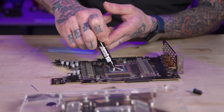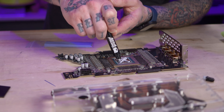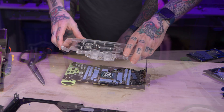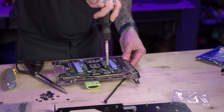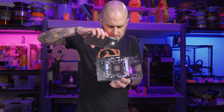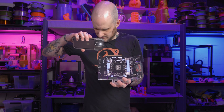Assembly is pretty straightforward. Apply some good thermal compound to the GPU die, apply thermal pads to pretty much every place you can, and line everything up so you can get it all screwed together. Once I have the block installed, I take a careful look between the PCB and the block, just to see if I can see any gaps or any points where a thermal pad might be in the wrong spot, holding the block off of the GPU die or a memory chip. With the water block installed, everything's ready — I could swap this into the system and re-plumb it. But I'm actually going to make an even bigger change.